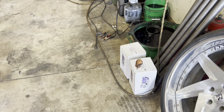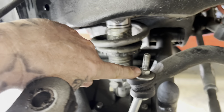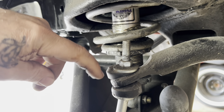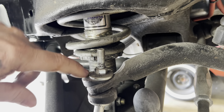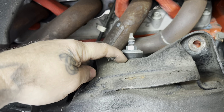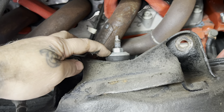The new springs are right there — they're black, I'll take those out of the box. Throwing this control arm back on. You see how tight they put this? That's way too tight. You want just about a finger's width, maybe a half-inch of thread sticking up. If you tighten it too much it ends up cracking the rubber and breaking the link. Same with the shocks — I've seen people run them all the way down flat, and you're not supposed to do that. Just a little bit of clearance is perfect.